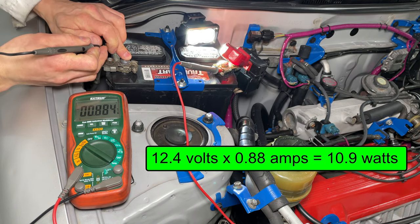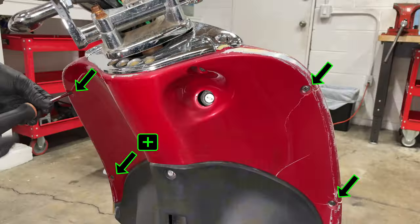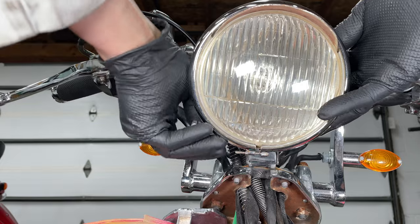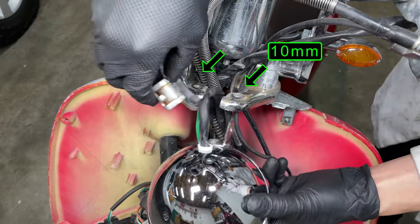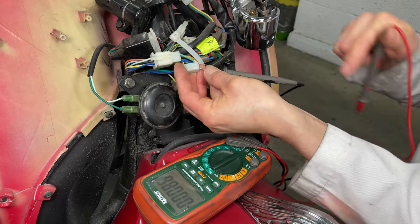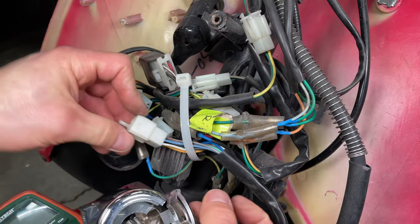Chinese scooters use the lowest quality plastic for the body panels, so Gorilla Tape does a better job holding things together than screws. Let's get that front panel off. The headlight is held on by a bolt and a nut, and two small bolts hold the headlight bracket. I'm unplugging the headlight and testing the voltage with the engine running — the low beam shows 0 volts DC. Switching the voltmeter to AC — this scooter uses alternating current instead of direct current for the headlight. The LED bulb I used earlier was compatible with AC, but the new LEDs require DC, so I'll need to rewire the dimmer switch. Now I'm rotating the terminals 180 degrees to swap the high and low beam wiring.